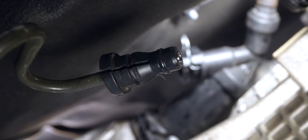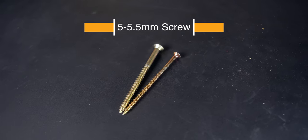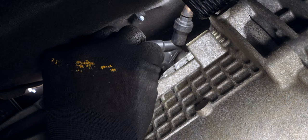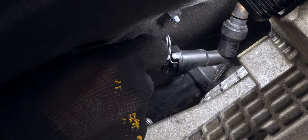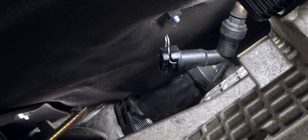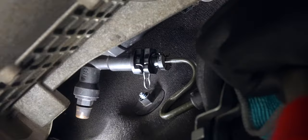Fortunately, the seal for the clutch line stayed attached. Place the line off to the side and grab your wood screw — it should be 5 to 5.5 millimeters in diameter; anything smaller won't work. Once you put it in, turn it by hand and you should feel it grab onto something. What you should pull out along with some fluid is the retainer for the clutch delay valve. Don't worry about reinstalling this. Clean up any fluid, go back in, and this time you should pull out the clutch delay valve itself. Congrats!